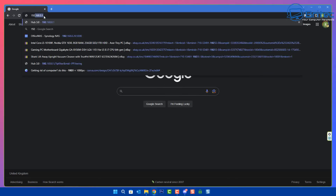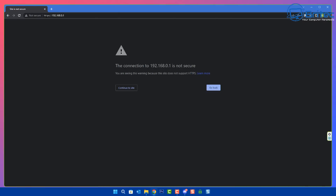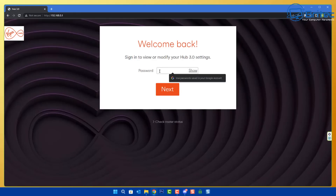To do it, all you need to do is open up your browser and type in the IP address for the router so you can log in to the main menu. Once you put in the IP address and push enter, you might see a security screen — you can continue to the site because it is your router. You will then see a password page and you'll need to put in the password for that router to get into the actual menu.